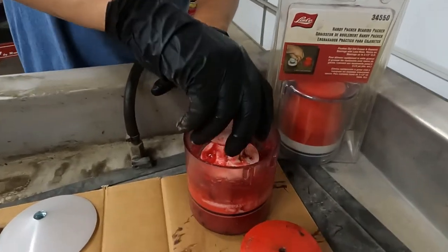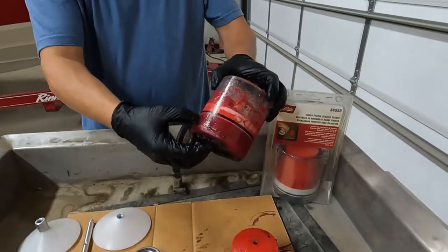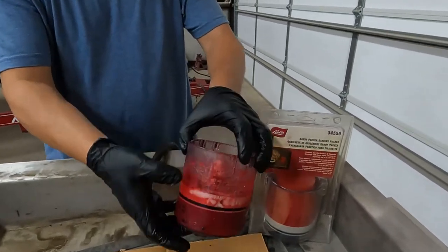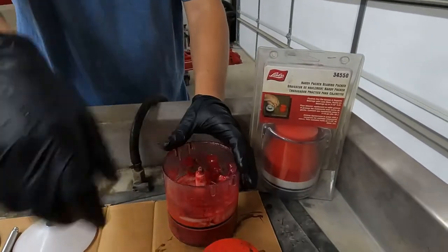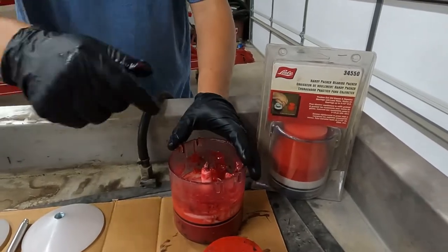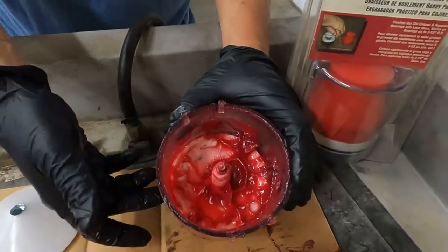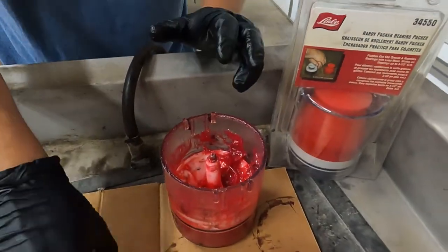The way this one works: this is your cone that presses the bearing down. It has a reservoir that you fill full of grease — you can actually put a lot of grease in here — and you have two ways to do that. You can use this to pull the plunger out and fill it full of grease by hand, or you can use a grease gun and attach it to the grease zerk, and it will pump new grease into the bottom.